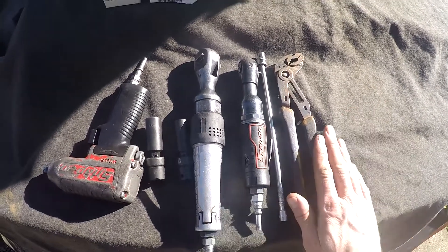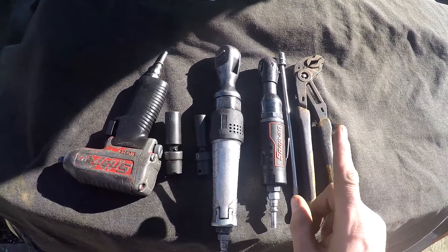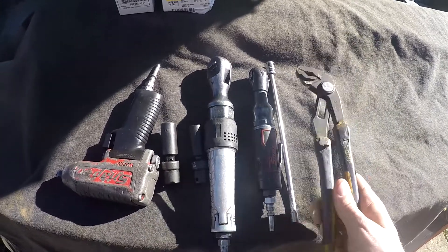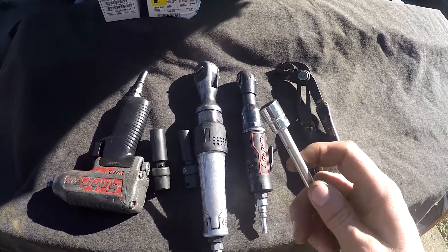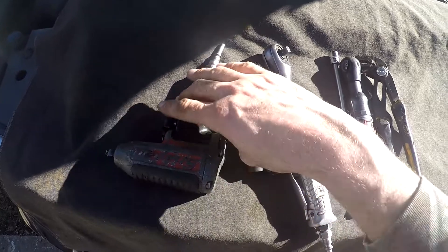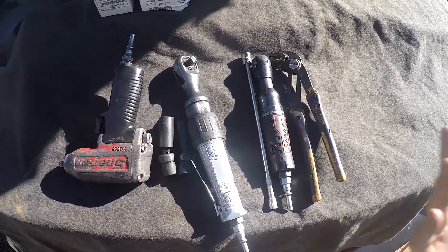So this is what I got for tools. I do these all the time and I basically know exactly what I need. You're going to need a pair of pliers just to disconnect the rad hoses with the factory clamps. I use about a 12-inch extension on a quarter-inch drive with a 12 millimeter on the end, a quarter-inch air ratchet, a three-eighths air ratchet, a 13, a 15, and an air gun. You could do this with hand tools if you so desired, but I'm not.